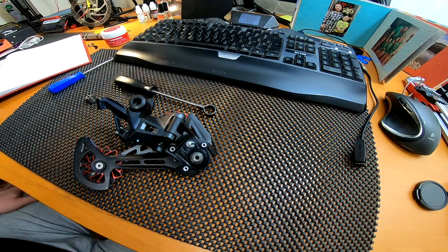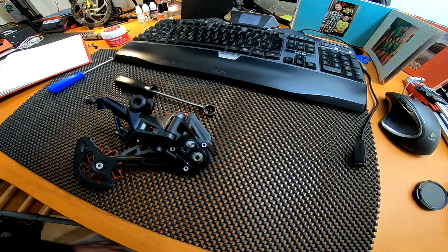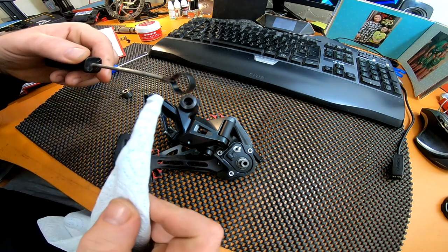If you look very closely, you'll see there's no grease at all in there. It's still nice and shiny with a tiny bit of residue, but there's no grease — that's what's causing the issue and why the clutch is sticking when it goes down, because this is actually getting jammed inside there. So what we need to do is get some paper towel — give me one second while I run to the kitchen.